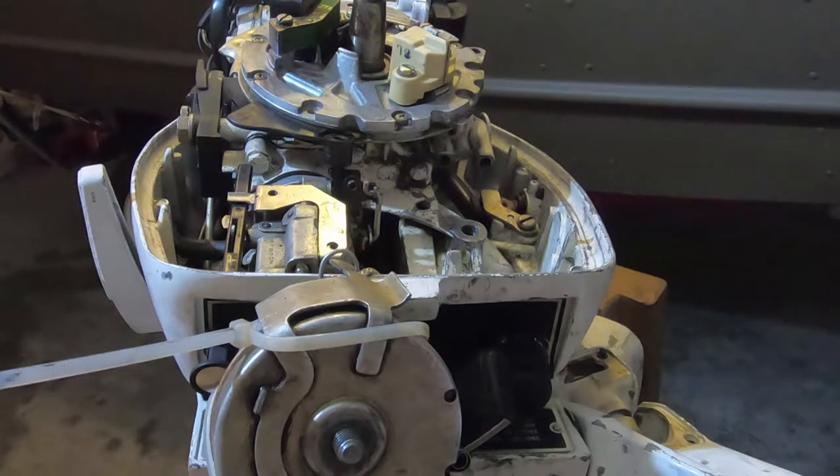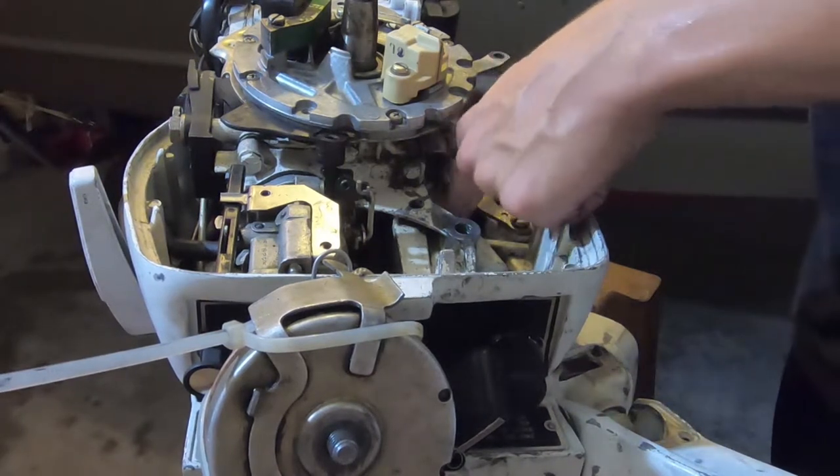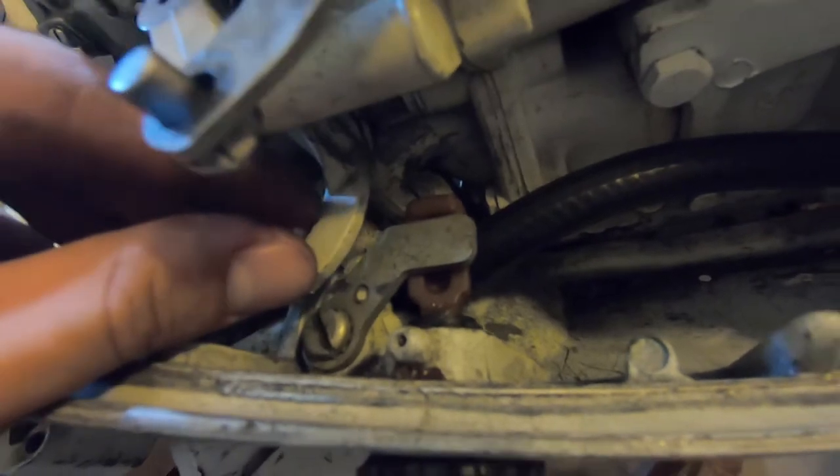Let's see if the gears are timed right. The two gears are definitely aligned — we've got a dot and an arrow coming together. Here it is at idle, and look how much play I have between this and the adjustment screw. Even if I adjust the screw 100% in, I'm not anywhere close. That is at idle right now. Somehow this needs to be turned so it's closer, but still at idle. I need to do more looking to figure out what's going wrong.